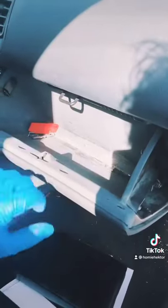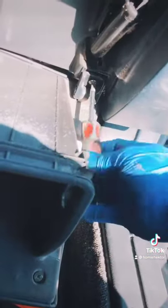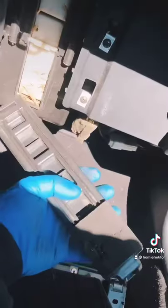The first thing we got to do is take all the stuff out of the glove box — yes, we all have stuff in there. Remove the little clips and the little screws so we can take the glove box down. Keep in mind that not every car requires you to remove the glove box, but since this is a Honda Acura, the glove box comes off.